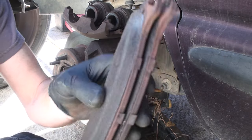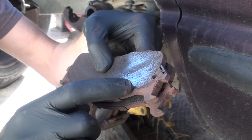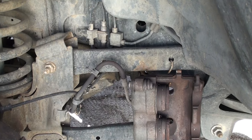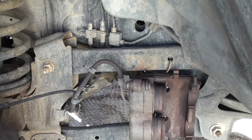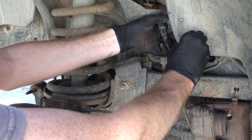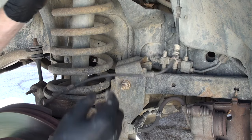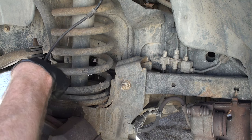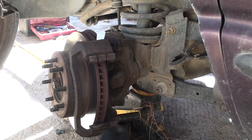Good thing I checked — take a look at the pads left on this. It was on the scraper, almost into the metal. To hang the brake caliper, I'm just using one of the S-hooks from a rubber bungee cord — seems to work pretty good. You'll also need to disconnect the ABS sensor; the plug is on the back behind the splash guard and goes down to the back of the wheel bearing. Just unplug that and hang it off to the side. The easiest way to get these caliper mount bolts off is to use an impact wrench — it's 18 millimeter.